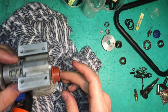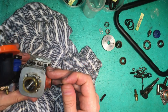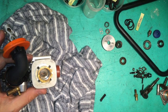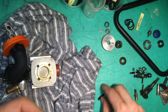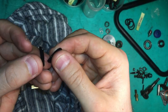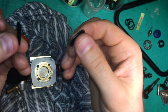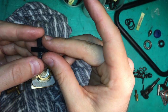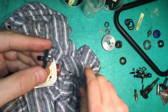Now, if that didn't work, look how many ports you've got. You've got four ports in a Hyper 21 three port, because you've got three inlet ports and an exhaust port. So what you can do is utilize those ports to your advantage. Put some zip tie in two ports, put it in three, put it in all four, make a crisscross, and then it's even pressure and you've got more lever action.